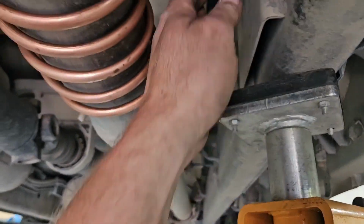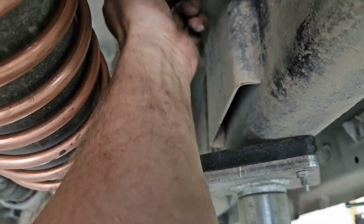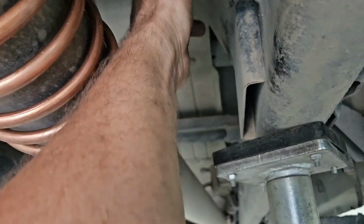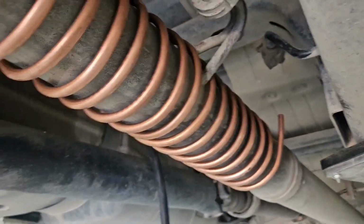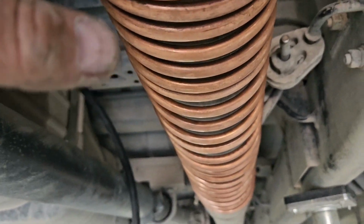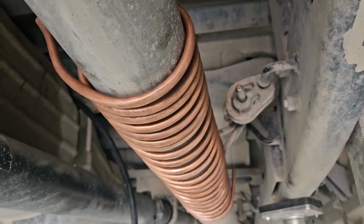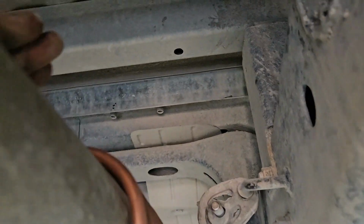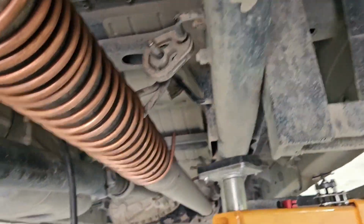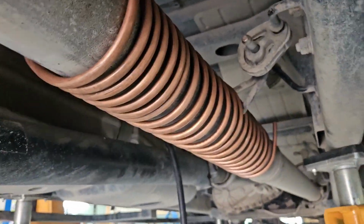And then I decided to stop it where I happen to have a factory old exhaust hanger that has not been working. And I can zip tie or whatever I need to that pipe, give me things to clamp to up there. And it just gives me a nice end point for it to clamp to. I kind of wish I would have coiled it the other way around and had my off over here. And that way my other one would have been over here, closer to the fuel pump. But I'm not uncoiling this whole thing and redoing it. My arms are actually tired from doing that. So I'll just have the rubber hose come across to that. The other reason for the rubber hose connections from here to there, and not running the copper right to my little tank, is flex and movement and vibration.